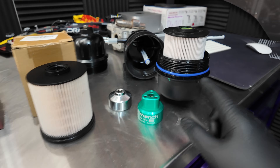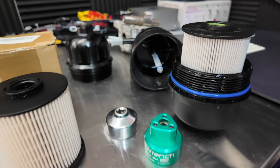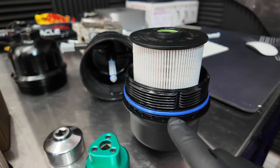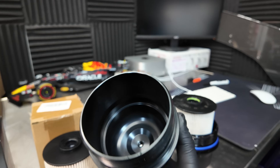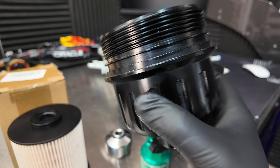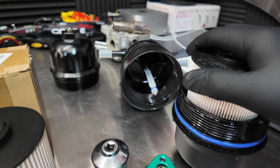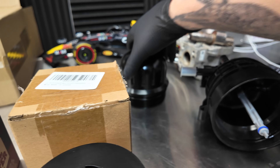I've gotten a lot of messages saying the filter is seized on and they can't get it off. At that point I suggest you replace it, because if there are any cracks or if it isn't able to seal up, you're going to have a leak and that's a big problem. Also, these aluminum fuel filter bases — yes, I think they're pretty neat because they seem to be more durable, but there are some questions about how great they are in wintertime and whether they're more susceptible to the fuel freezing or gelling — I can't answer that. So run that at your own risk, but I do think these are great for the long term.